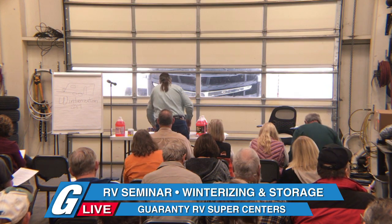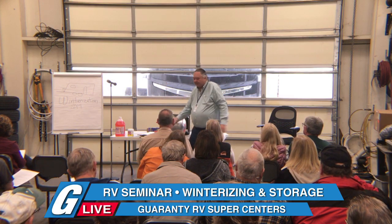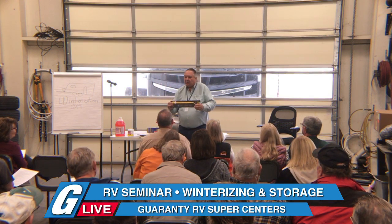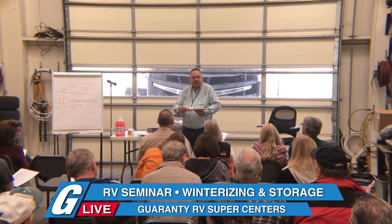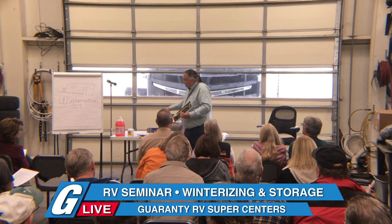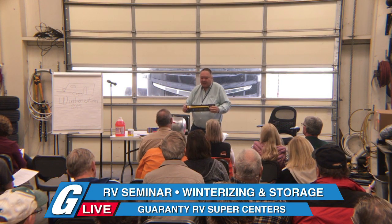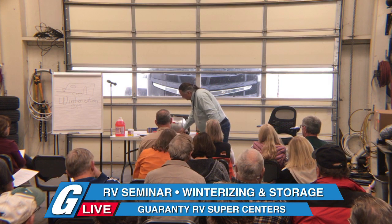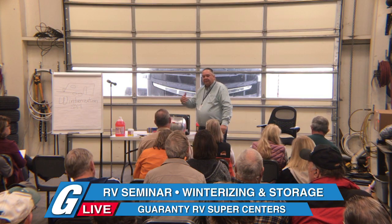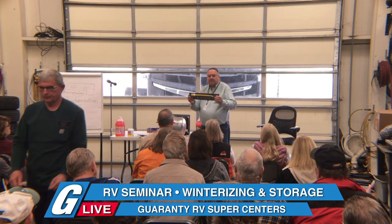When you're getting ready to winterize, you take the plug out of your water heater and it'll spray some of this out. Then after you're done with that, you buy one of these and you hook it up to your hose. It has an on and off spigot, and you stick it into that hole, turn it on, and it'll blast the other 3/4 of my mom's oatmeal out, and you can rinse out the bottom of your tank. That plug is about this height right here, so anything below that point will not drain out, and that's why all of this stuff collects there. These are cheap, they really work good.